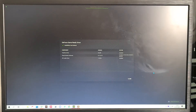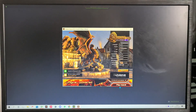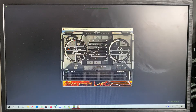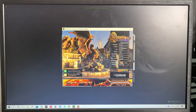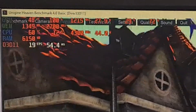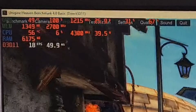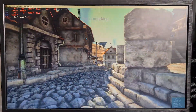All the latest GeForce drivers are finally done. We are going to be using the faithful Heaven benchmark to test how well the GPU performs, and to monitor it we are going to be using MSI Afterburner. Right at the top left it tells you our power percentage, utilization, and our temperature, which is what we are interested in. So I am going to hit benchmark and let it run a couple of times, and we will get back and see what the results are.